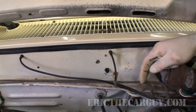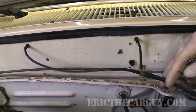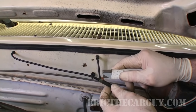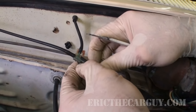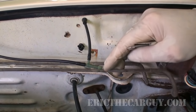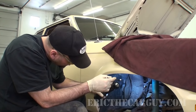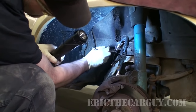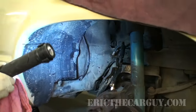One thing you may notice is the windshield washer hose is also in the way. Being old and crusty, I'm going to employ a slightly different tactic — I still have more of this hose plus extra line if I need it. So instead of pulling it off, I'm going to do what I often do with old hoses: I'll use a small razor blade, slice it down the center, and peel it away like an orange. This means I don't break these tiny plastic pieces, and now I can get the brake line past it without any problems. The final connection of this brake line is at the brake hose, so I'll knock it loose and push it through that opening.